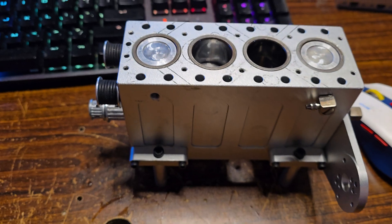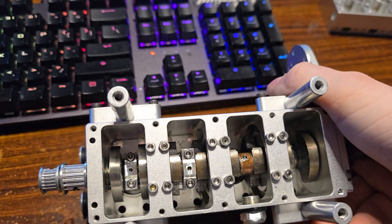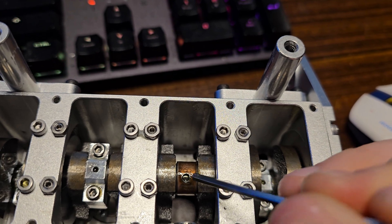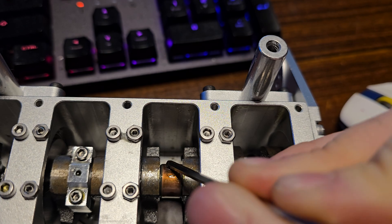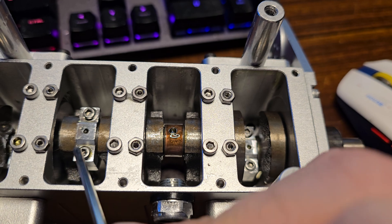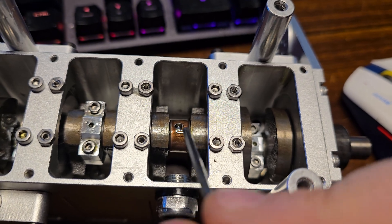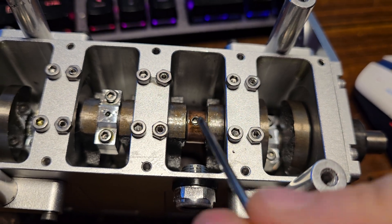Your pistons are actually really, really well designed. In fact, compared to all of my other engines, these are over-engineered. You can see this copper-type bearing here — I'll carefully rotate it for the oil inlet into the crankshaft and you can see some oil pushing out. So they ride on dedicated bearings. Most engines just place the connecting rod right onto the crankshaft or have a simple basic bearing, but this has an actual dedicated bearing. I love it.